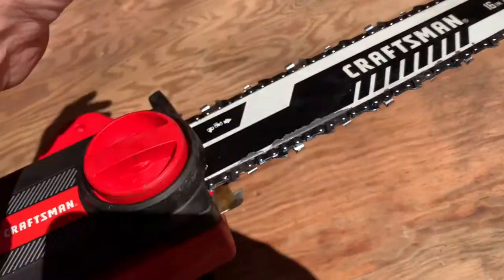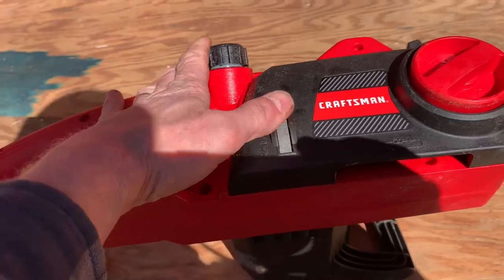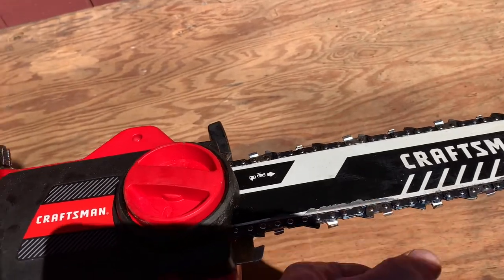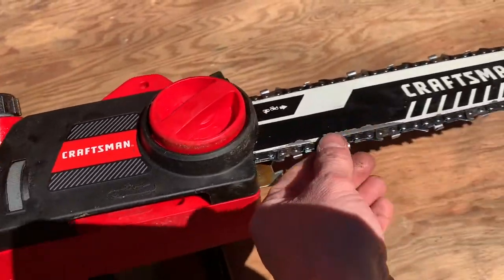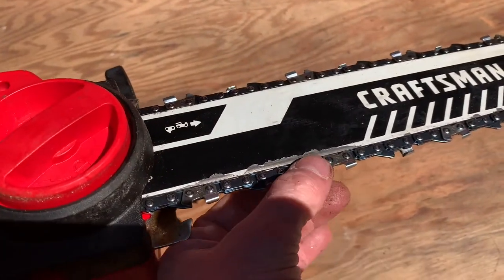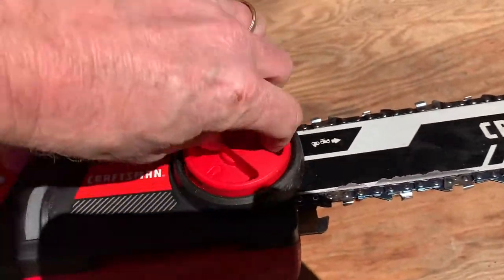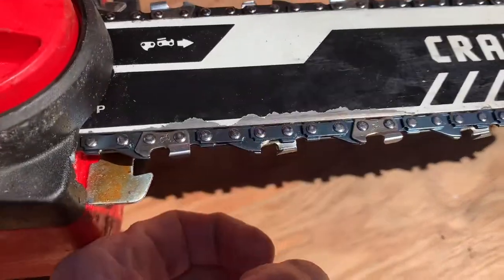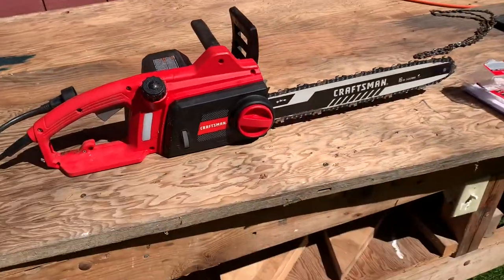I don't want this to be too tight or it won't tighten the chain, so back it off just a little bit. Tighten the chain and then back that off a little bit — make sure that's loose enough. It snaps back right about there, yep, it's perfect. Now we'll just crank this down all the way. That's what you want. Now it's ready to roll. Thanks for watching!